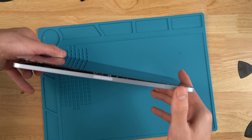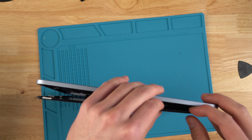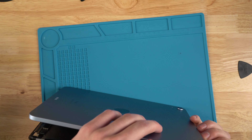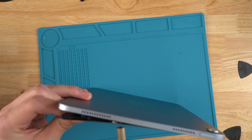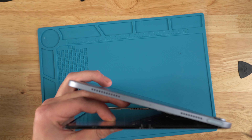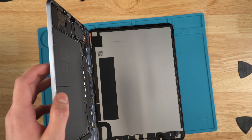For reference, the volume up and down buttons are on the right side of the iPad — you want to peel from the left side, because there are LCD ribbons located on the right side, and if you do not want to rip them, your safest option is going from the left. There is some fairly strong adhesive on the top that you may need to go in with a flat head or spudger to carefully cut off. Now we'll be slowly opening the screen.